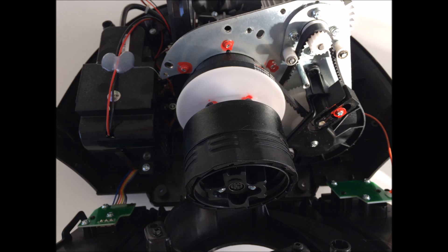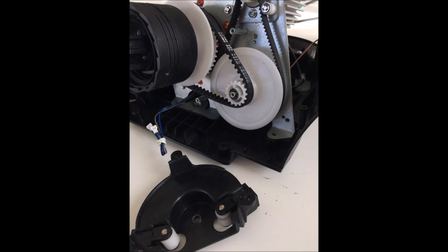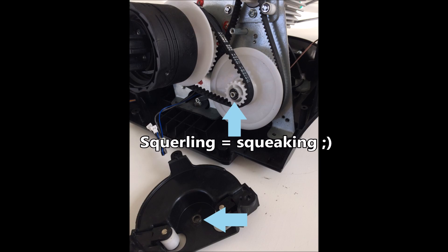The electronics are on the other side, so no worries about damaging things. But I must state that doing this repair or maintenance on your own will surely end your warranty — think about that. I detached some kind of belt tensioning plate, and after that I tested putting some additional grease lubrication on the shaft on the bottom right. And voilà, the squealing noise went away immediately. I guess the grease lubrication applied from Thrustmaster at the factory is not enough.